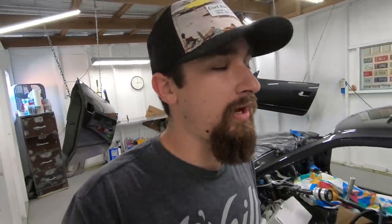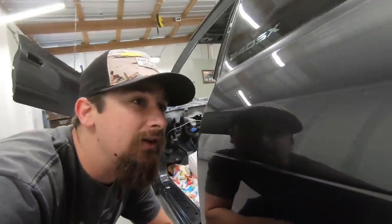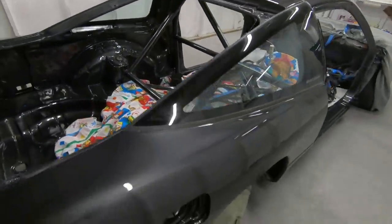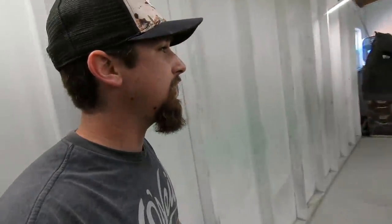This job already has a very minimal orange peel look, so that's just going to make wet sanding that much easier. When I give a full review about my DeVilbiss DV1 setup I'll also let you guys know what pressure I'm spraying with, what I use for base coat, what I use for clear coat, and go more in depth so you can get a job like this on your paint jobs if you're interested. Overall, a really successful day. The reflection is deep — you can see really good depth and it looks really good. I'm happy with it. We're going to wet sand it so it's going to look that much better. Every once in a while you can pick up one of those dust specks in the light, but that's just what happens — all cars have that and you wet sand them out.